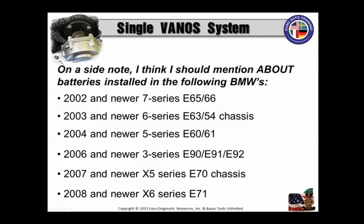What this is all about regarding these particular models is registration of the battery when you replace it — it's a must on these newer BMW models. Also, don't forget to check the AC ripple on the charging system. System electronics do not like AC ripple and will cause all sorts of weird and wild things to happen — for instance, the DME going stupid, thus causing a very possible performance issue, especially related to the Vanos operation.